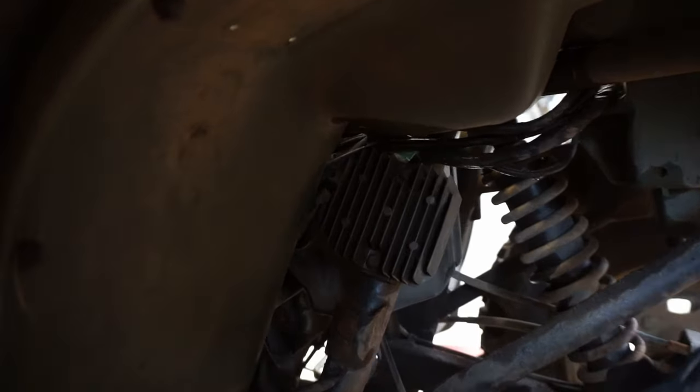All right, looking at this forum here, it says for this particular machine, you should see voltage rise above 12 to 14 volts. This indicates your battery is charging. If you see the voltage climb above 14.5 volts, shut it down and replace the regulator rectifier because the regulator side of the unit is fried.